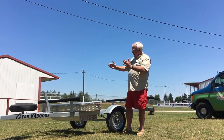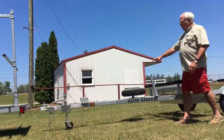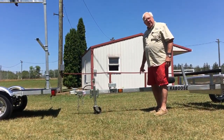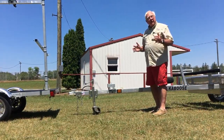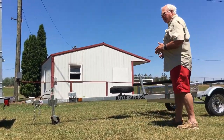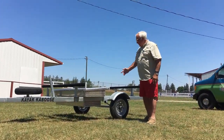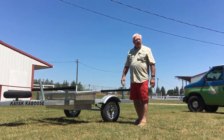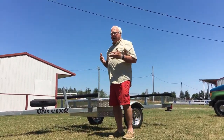We build it on a rectangular frame so that the actual amount of exposed tongue is only about 6 feet. We like to say our design is much more like a mousetrap — substantial versus most of our competitors, who have a longer tongue, thinner-gauge steel, and they come off a little box in the back, a 4x4 which houses and supports the axle. Here we have an 8-foot long rectangle with a 3-foot high triangle, so we think the support is great.